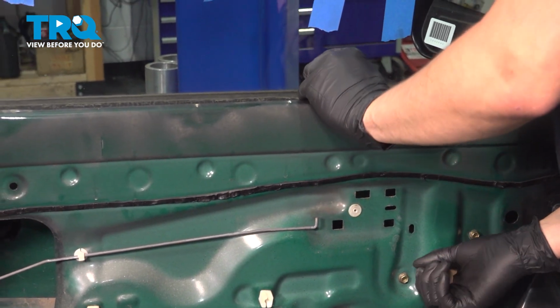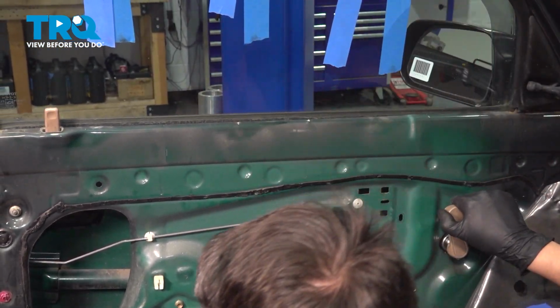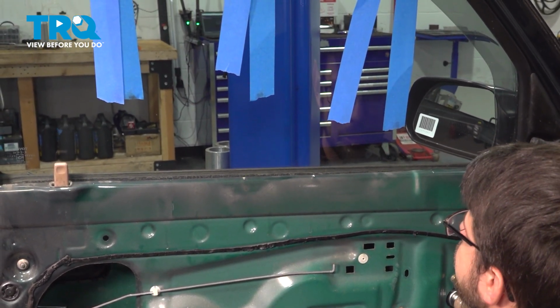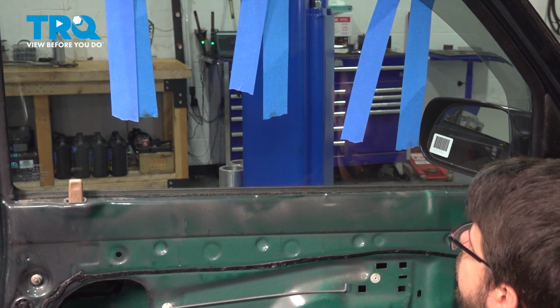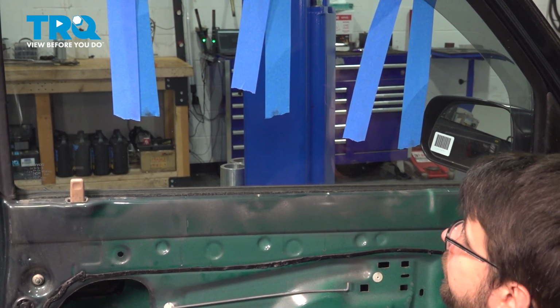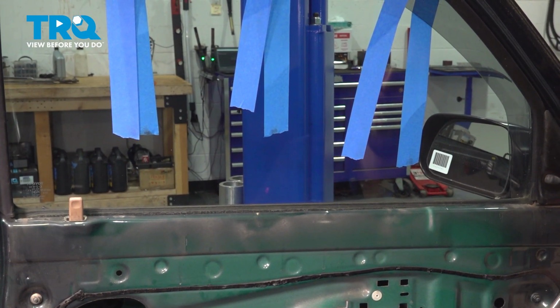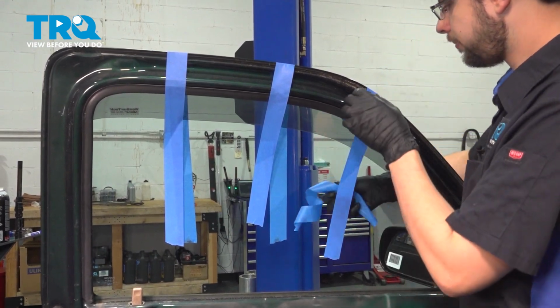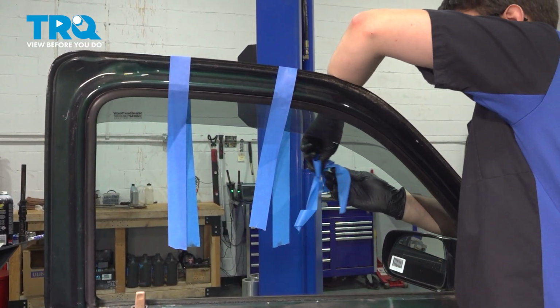You can kind of see where it's supposed to be, where you can stick your hand in here. And you want to make sure that it actually slides onto, there we go, that just clicked into place, slides onto the glass so we can hold it securely, so we can remove the tape, lower everything, and re-secure the glass onto the regulator. Slowly and carefully remove the tape. Hold the glass just in case it does want to slide down, of course.